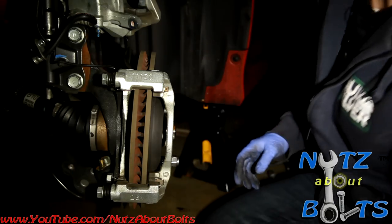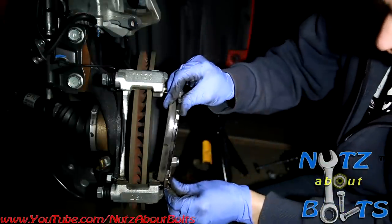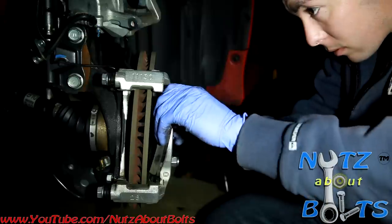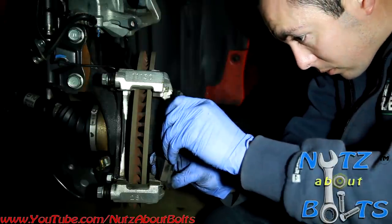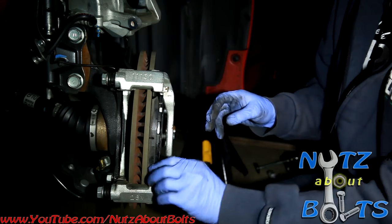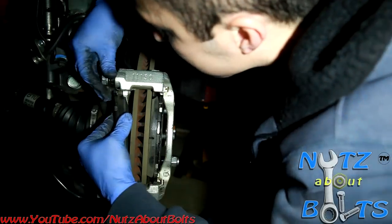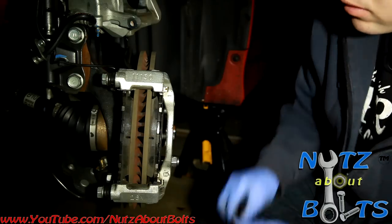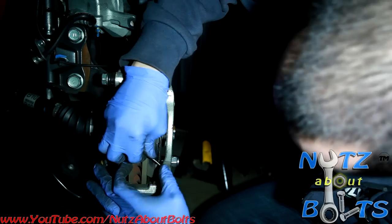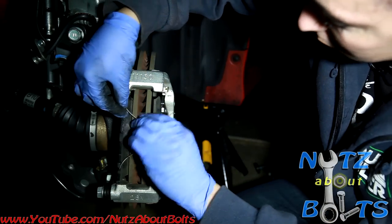Okay, and then the next thing to do is put our brake pads back in, and actually, I think we had them like so. You gotta watch out for the little spring down here. There we go. Okay, yeah, so there's a little spring in the fit kit that you have to push the brake pad into and make sure it all lines up. Alright. And we gotta put our little springs in. They go into the little holes here. So that's going to push the pads out a little bit, so we're going to have to squeeze them in together when we go to put the caliper on.